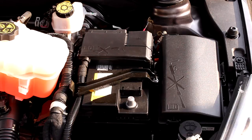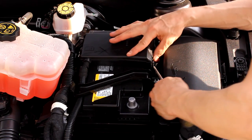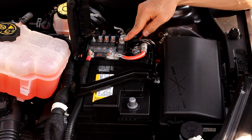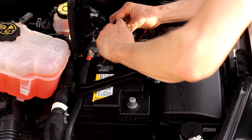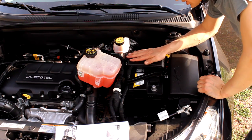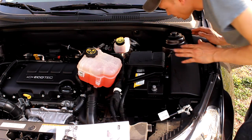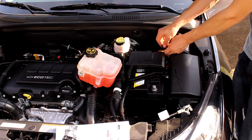So we got our two wires going through. Now we're going to hook up the power wire — open this fuse cover, it can be a little tricky. We're hooking to the 250 amp accessory, it's the first one, and you can confirm which one it is — it's a 13 millimeter socket. So we got the wires connected. Close the fuse panel up and make sure the wires are out of the way and not rubbing on anything metal. If you have some zip ties, throw them in — you want to make sure you can access the fuses.